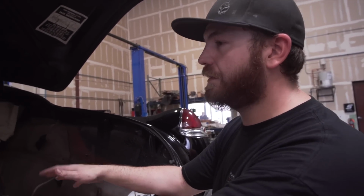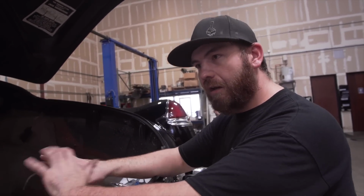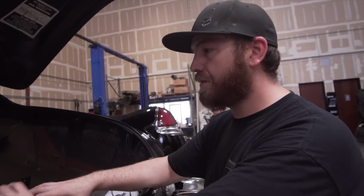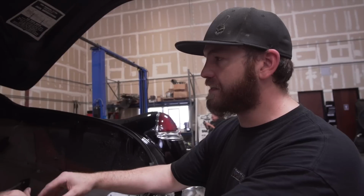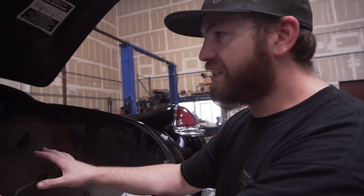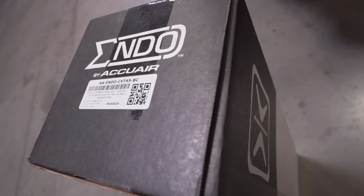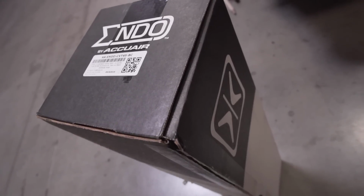Got the tank all mounted. The customer originally wanted all of the air ride hidden as much as possible. We wanted to keep the factory look, don't want to see air tanks, all that stuff. So we went with the CVT because it's a tight, small package. We were going to put it under the car so you couldn't see it, but when we started looking around, there just wasn't a lot of room. It would hang below the frame, possibly get damaged from the road.